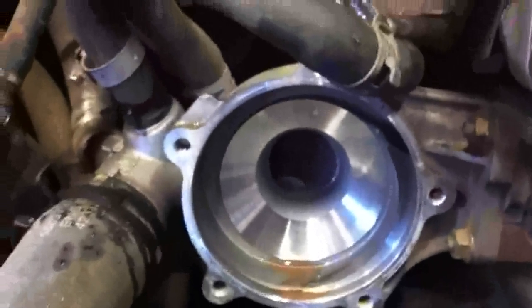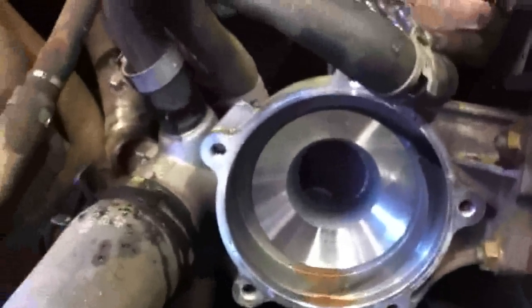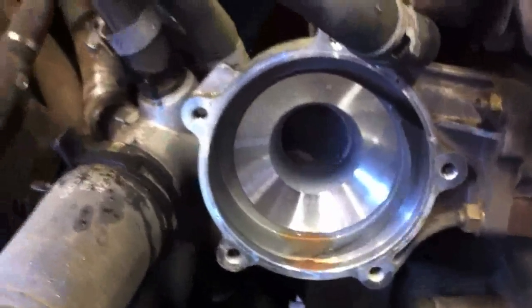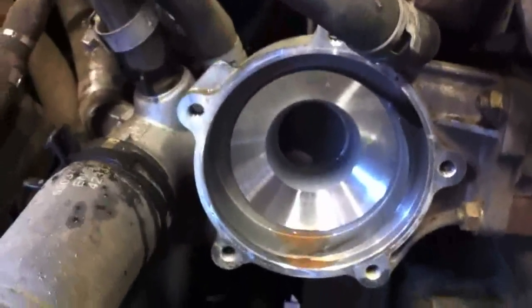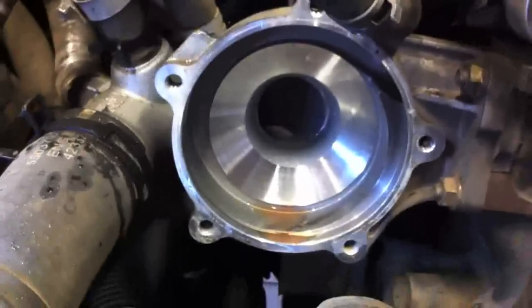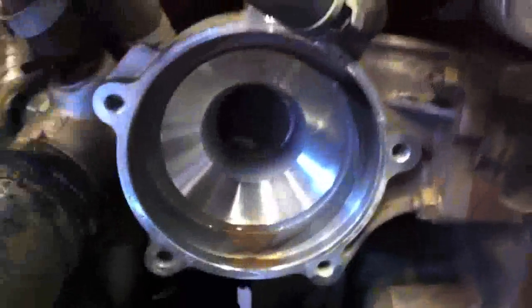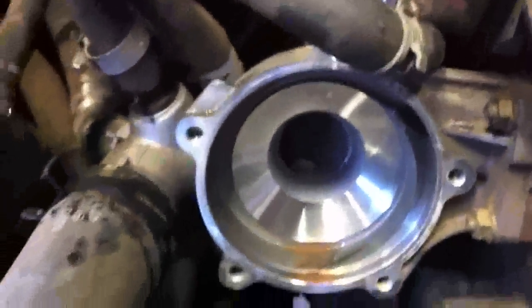Here's what's left of the water pump housing — this is the old housing. We'll leave it there. A little bit of dirt got in, but otherwise there are no moving parts in this. It's sealed up at the block and sealed at the back, so we'll just leave those sealed. There's no reason to replace any of those since we're not messing with them. The only thing is it will have a new seal right in here with an O-ring. Let's go take a look at the new part.